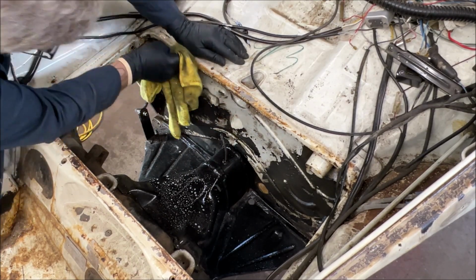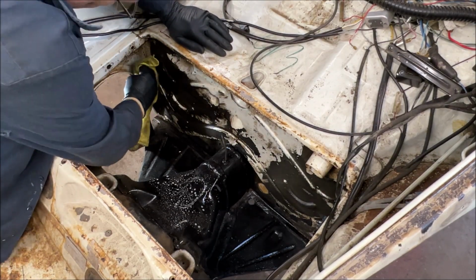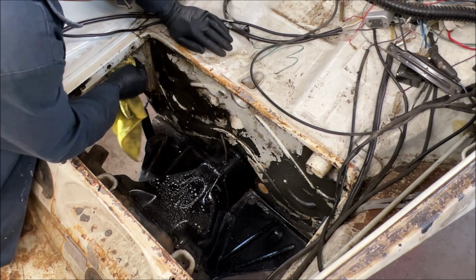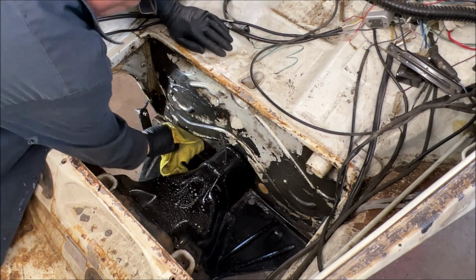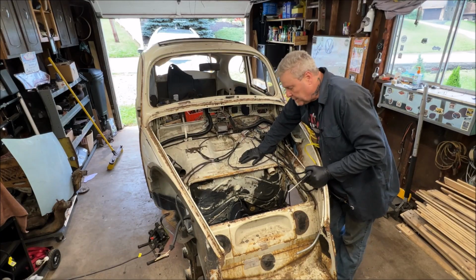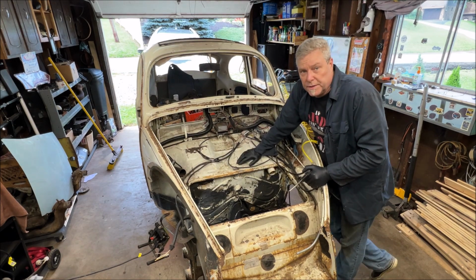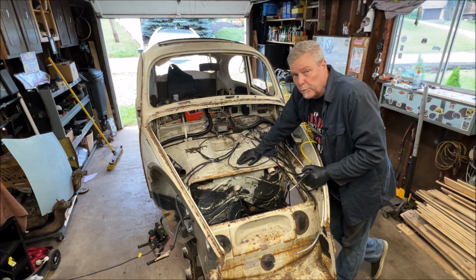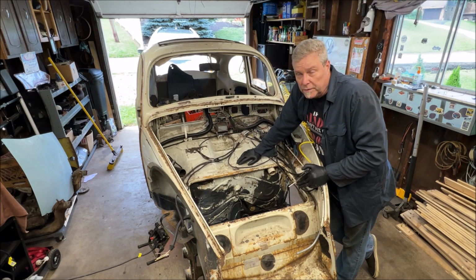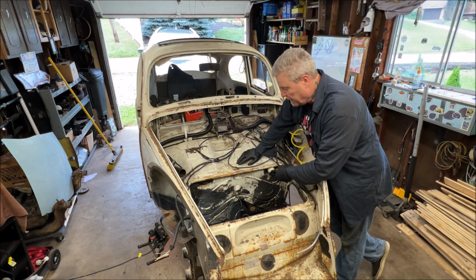I'm going to go over something important that my rep got a hold of me with the rust bullet and said. I'll go over that in a second while I'm mixing the paint. Okay, so I went ahead and I wiped everything off with that awesome that I use. Like I said, use the metal prep if you've ground down the bare metal. That conditions the metal. I'm not a scientist. I don't know how to explain it. Just do it. Okay, let me blow this off.